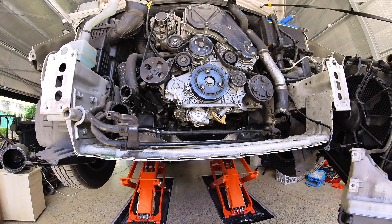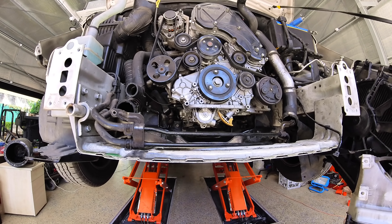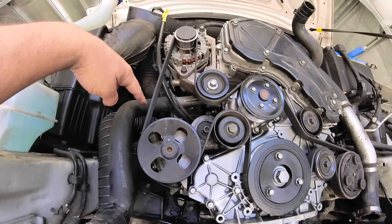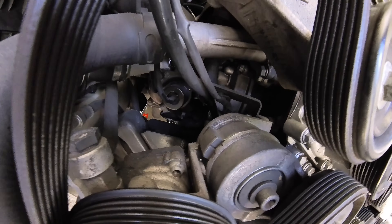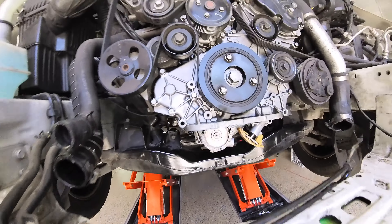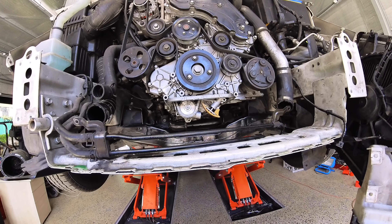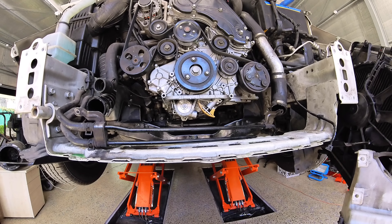Even with the oil pressure - I gave it to my mechanic, asked him for two days, he finally did it and said six PSI. That might be correct, but it took me half an hour to get the sensor in myself. The oil pressure sensor is right there underneath the alternator - you can't get to it from the top, you've got to get to it from the bottom and unscrew it, then screw in the pressure sensor. That took a good half hour, 40 minutes. My mechanic didn't charge me for it, so I really wonder if he even did it, because that was a real mongrel of a job.